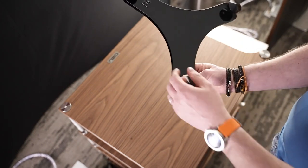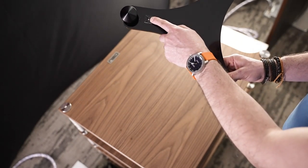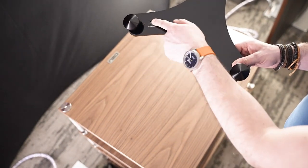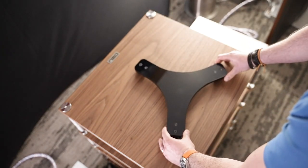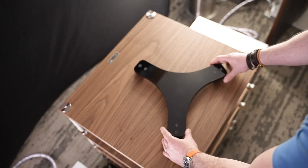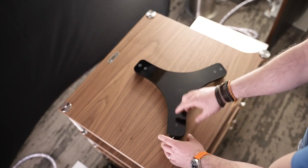You need to locate the rear leg of the turntable. The cable tie saddle underneath the Spyder is what denotes where the rear leg is — that will be where you cable tie your tone arm cables later on. So that needs to go to the rear. Place the Spyder roughly in position; we can move it around once we've got the rest of the turntable built up.